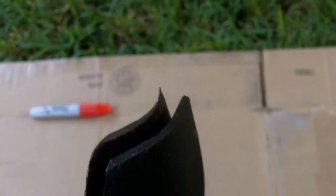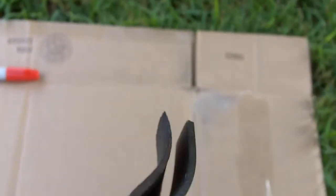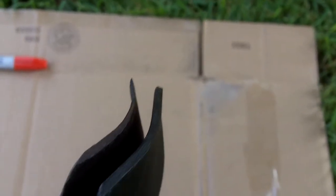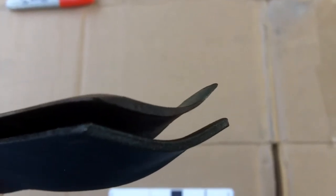That's almost to the point it will knock the blade out of balance. And no matter how many times you keep on grinding the edge, there's no way you can get this to balance, because I actually did try that on this blade, and it's impossible to get it to balance. And here's the other side, and it's not as thin, but it still is pretty worn out.